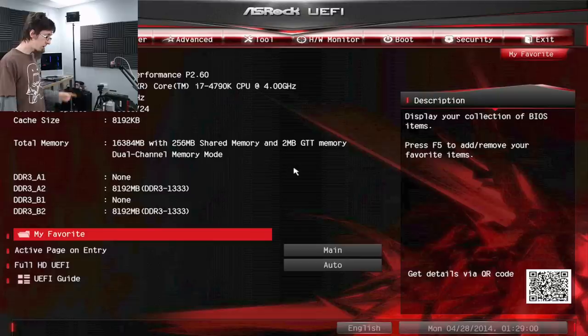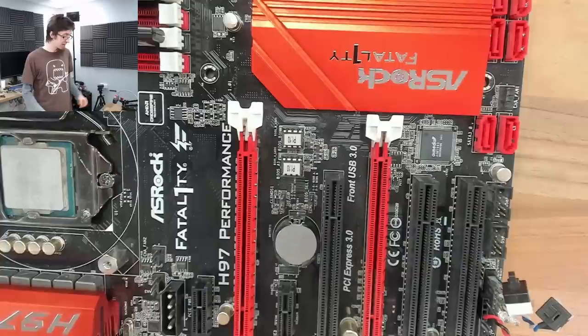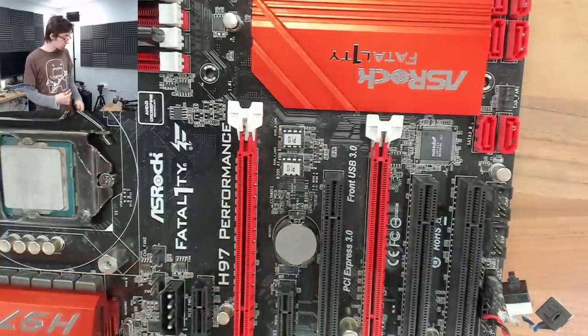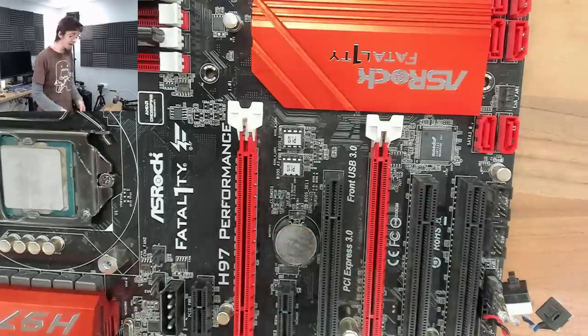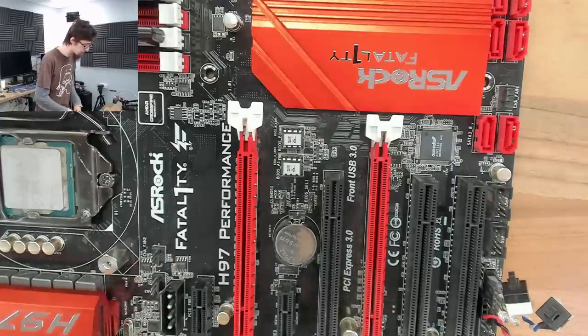So past that, we can reassemble now. Just one final thing before we get to the reassembly: if the backup BIOS had also been corrupted, we would have been in a situation where we could not recover the board on its own, and we'd need to pop one of these chips out and reprogram it manually — which is really easy on these old boards where we have socketed chips.